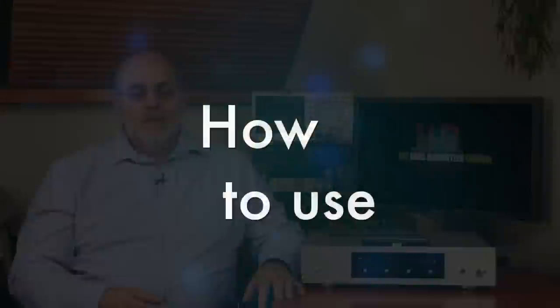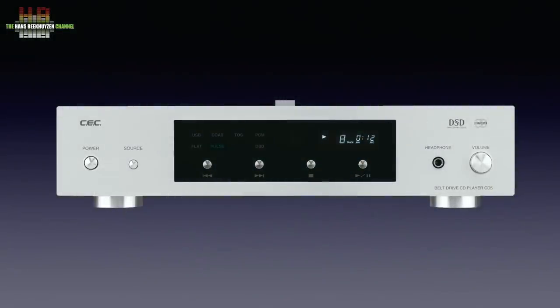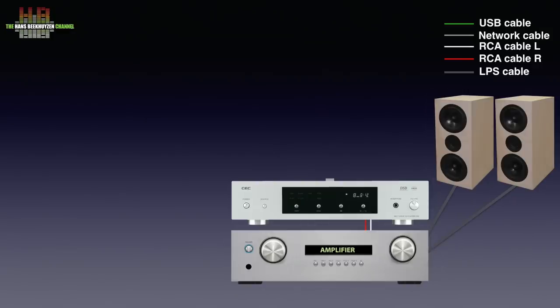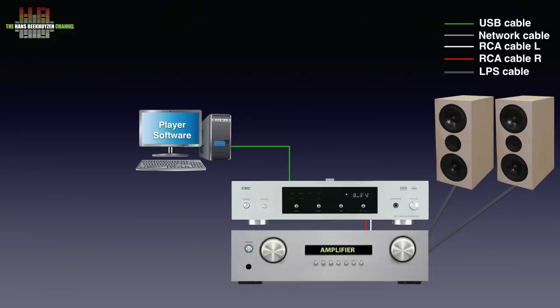Let's first see where the CD5 fits in the stereo. The CD5 is to be connected over analog cables to your amplifier using either RCA or XLR cables. If your amp has XLR inputs, these are the preferred choice for this player. You can load the CD and play it, or if you want to play music from your computer or laptop, you can use either USB, S/PDIF or TOS link to connect to the CD5.